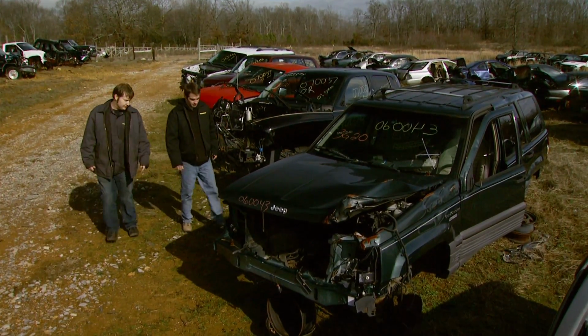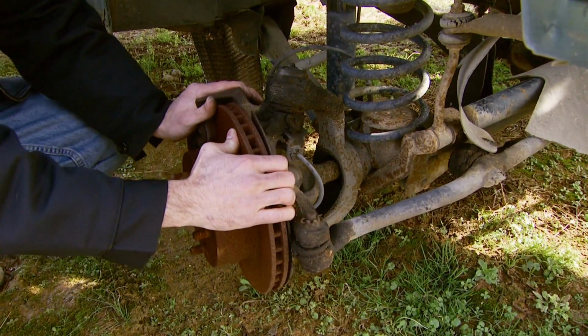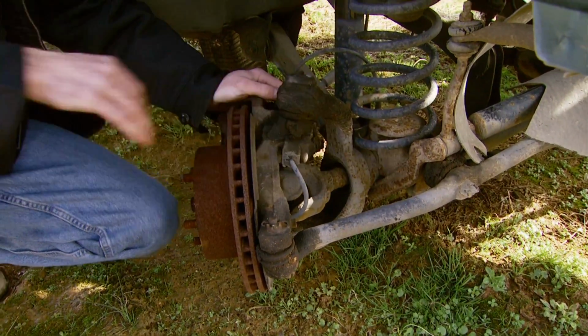Hey, that's it, isn't it? Yeah, see, ABS sensor wire. This wire tells us that this Dana 30 has a little bit larger 297 U-joint. The non-ABS equipped axle shafts have a smaller 260 joint. And while it's not indestructible, it is a good low buck upgrade.